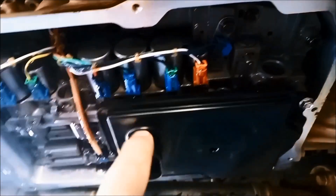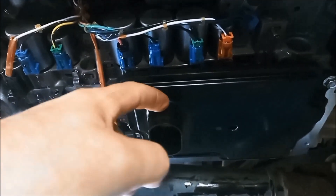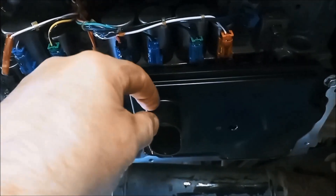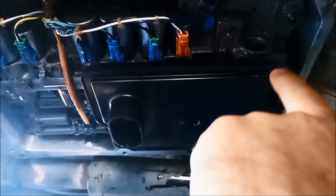As I mentioned, make sure you've got the right filter — not the two-wheel drive one, which is basically flat there with no snorkel. And also always check the O-rings on there.